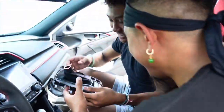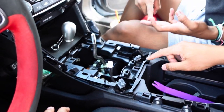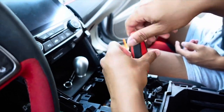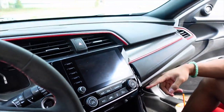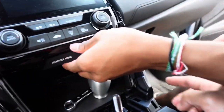These are the connectors for your brake hold, your sports or comfort mode, and your parking brake. You need a Phillips head screwdriver - you're gonna take this metal screw out. Now we're gonna have to take the AC head unit out as well - there's gonna be two Phillips screws on both sides right here. It's probably the same thing as the Si anyway.